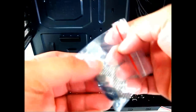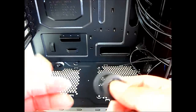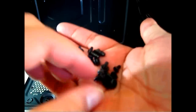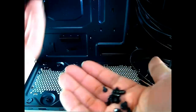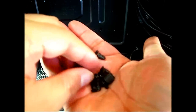There's also a small package containing nine motherboard standoff screws, rubber grommets for the water cooling holes — I'll show where those go later — and a standoff installation tool that lets you drive standoffs with a screwdriver rather than long-nose pliers, avoiding scratches. It's a nice inclusion even in a budget case.